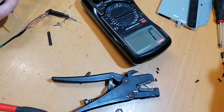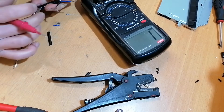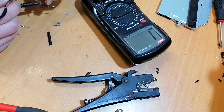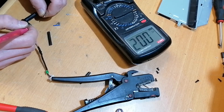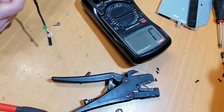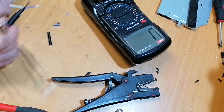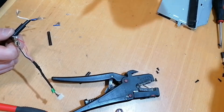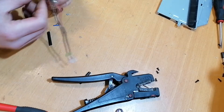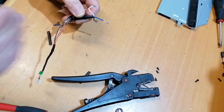I had the idea of connecting the charger directly to the board, so I cut the connector from the charger as it was damaged anyway. With a multimeter set on diode, I tested the wires to the connector to identify the colors used. Black from the charger is ground and comes to the outside of the connector and to the black wires on the charging port. Blue from the charger comes to the middle pin of the connector - the one that was missing - and to the brownish wire on the port.